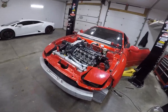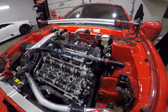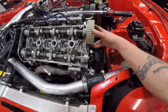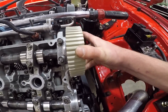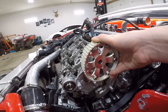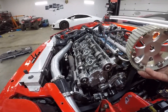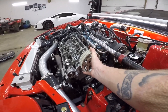The battery died on the camera. So — the dowel pin: there's play in there, and they both need to move towards the firewall. By default, if you're not holding any pressure, they fall towards the front of the car. That's why these two are out by a hair. Me being able to move them this much is exactly how much they're off. Jared is the man — I wouldn't have even thought about that. Gravity makes it rotate towards the front of the car, which is the direction they're off. When I tighten these down I need someone to help me hold them tight towards the back of the car.